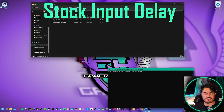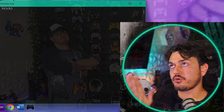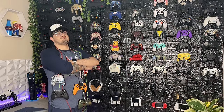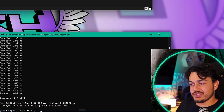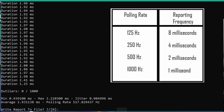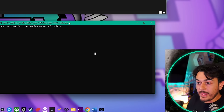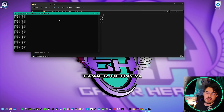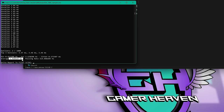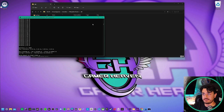Let's test the stock input lag by running X Input Test to test the refresh or polling rate. I'm going to move the left analog stick around in a circle. Although this controller doesn't need much attention right out of the box — the first pull, the first run out of the gate — 1.93 milliseconds, consistent as hell with a 0.9 minimum and a 3.2 maximum, under one millisecond of jitter. This is just a beast. That's about a 500 Hz stock polling rate wired. With the wireless dongle, we're getting 4 milliseconds of input lag at 250 Hz polling rate. So you're getting in the low twos wired and the high threes wirelessly. For most casual players, I'd advise just using that wireless dongle for the convenience — you're only getting an extra 1 to 1.5 milliseconds of delay, which is virtually indistinguishable.